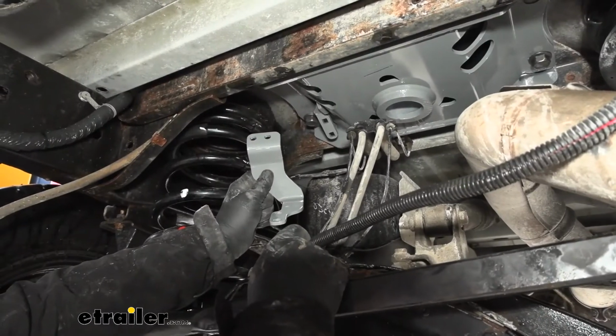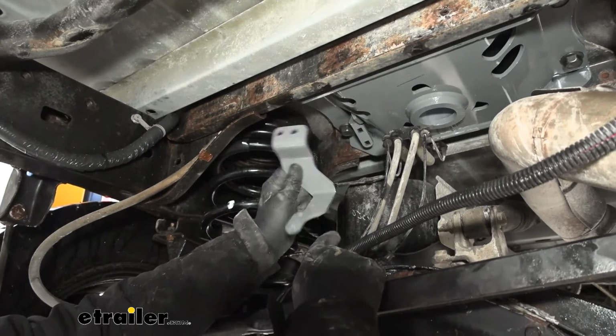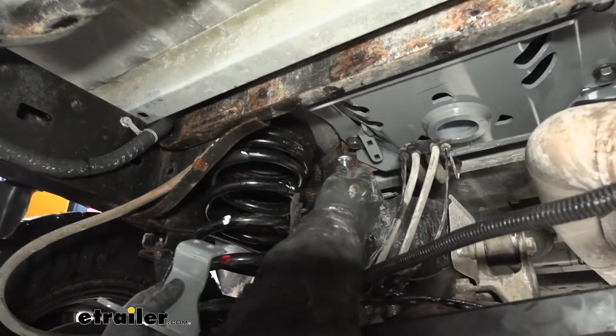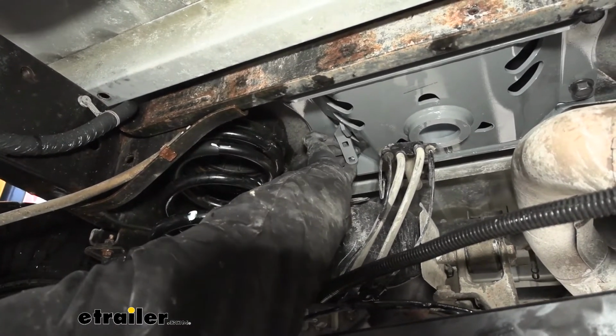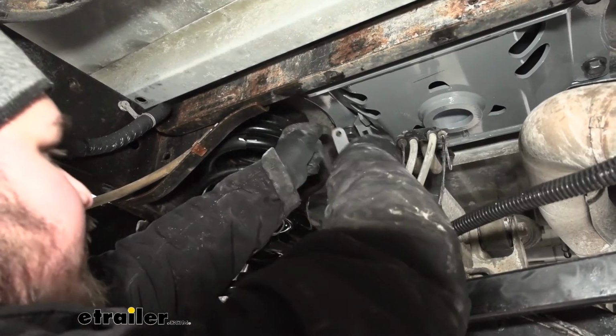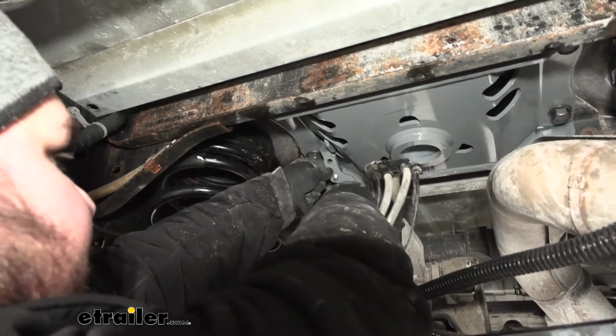We're now ready to get our handle extension bracket. This is what it's going to look like. We want the narrow section facing towards this, and on the back side we're going to add our smaller carriage bolts. So we're just going to slide those through the back of our handle like so. Then we can take our bracket, slide that end up and over our gas tank and push that onto there.